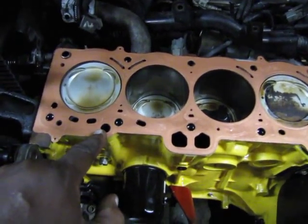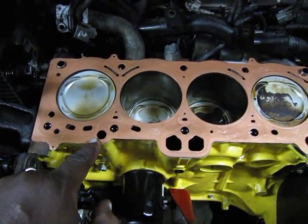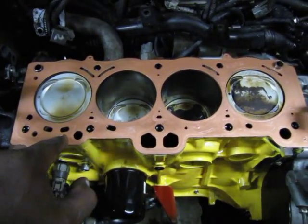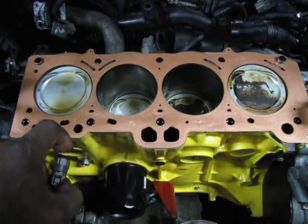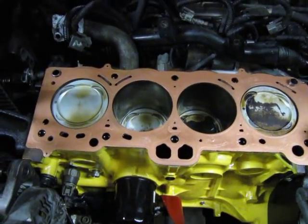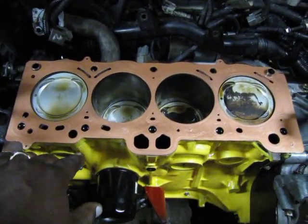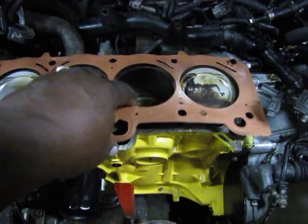This particular hole right here is how I found out. With the head gasket upside down, the head gasket slices that hole and half of that hole is exposed to the outside. The significance of that is this is one of the supply ports from the oil pump. I'll show you what that looks like.